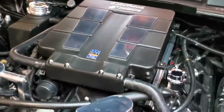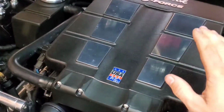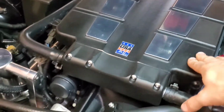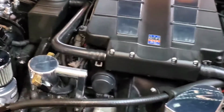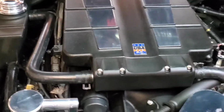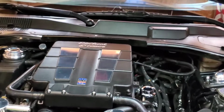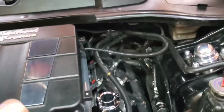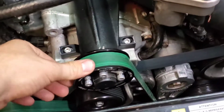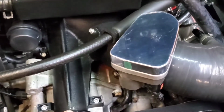But like I've said in some of my other videos, I've talked to the people at Edelbrock. They say this 2300 blower is about out of steam with a 2.8 or 2.75 pulley, around 13, 14 PSI boost. I see in cool weather 11.7 PSI with the 2.8 pulley, but you will also lose a pound to 2 pounds. I lose a pound and a half of boost where it has cam and headers. So if you add 1.5 pounds, on paper this is a 13 PSI pulley.